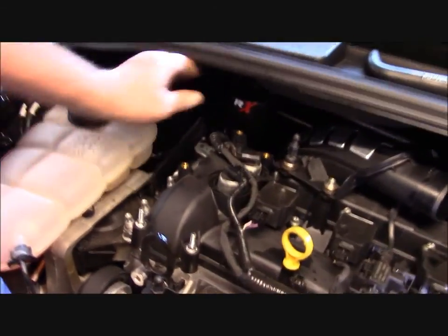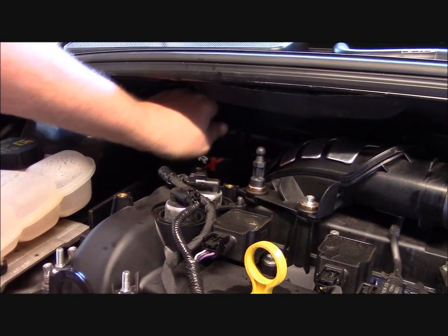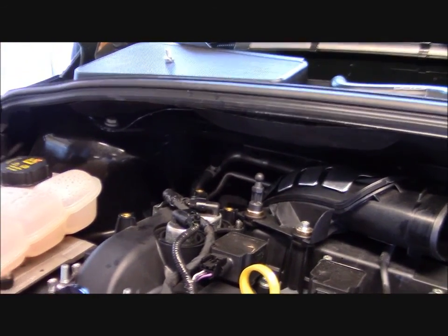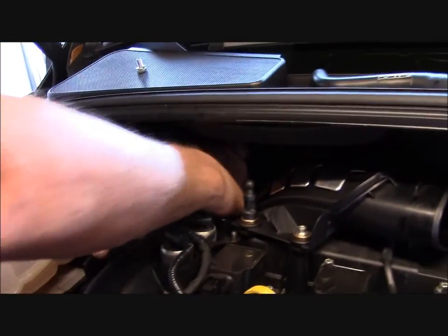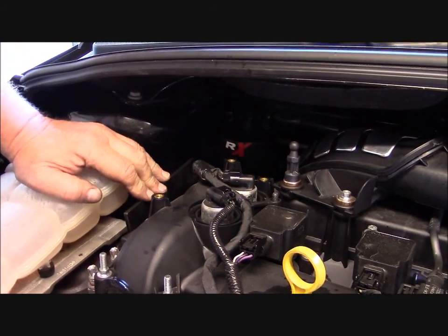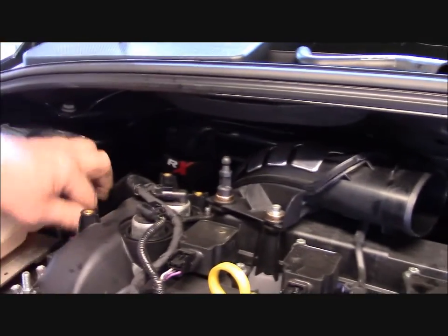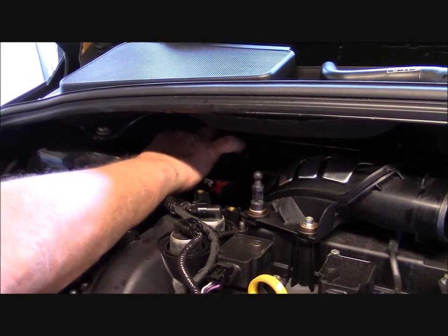It's very tight. This is going to allow us to have all of our fittings on there, and still be able to get down at it to drain the can. We want our drain hose here on, and we want that drain hose to protrude out the bottom. We're going to get it back far enough and feed that through so it goes into a good handy spot. When we drain it, you can simply put a drain catch underneath there. The drain hose is definitely helpful because usually you can get to the bottom of the can with a water bottle or something like that, but in this case, because it's so tucked in there, you're going to have to get under the car to catch that from the drain hose.